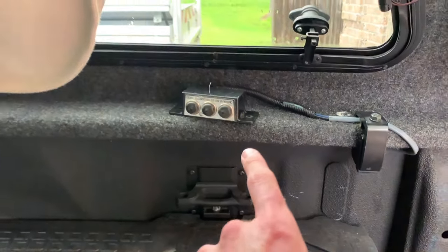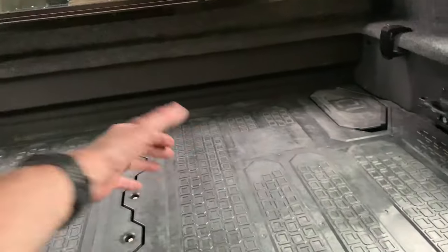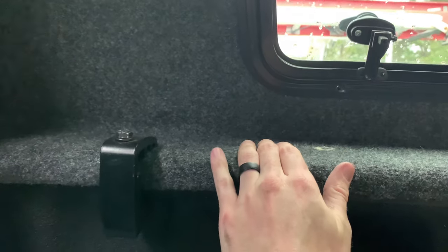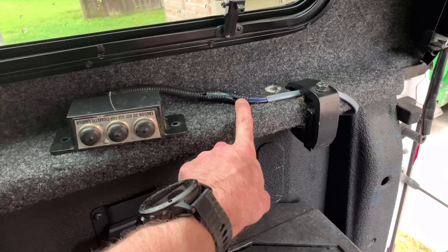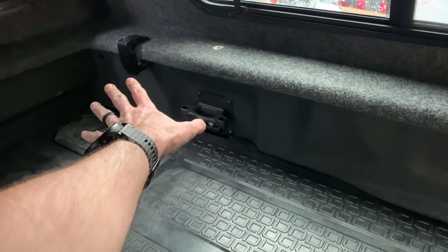Quick change of plans. I came in through here at first, but I've already got an outlet up here, and I plan to sleep on this thing. I'll be sleeping with my head this way. So I'm going to go ahead and run that outlet through this hole down and mount the cigarette lighter USB thing right here. That way, when I'm sleeping over here I can just reach in and plug it in, and this other one will be for the tailgate. So I'm going to go ahead and cut this, pull this down through, unzip tie everything I had zip tied, and run it down through there.